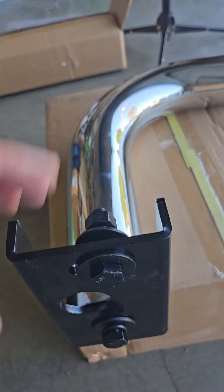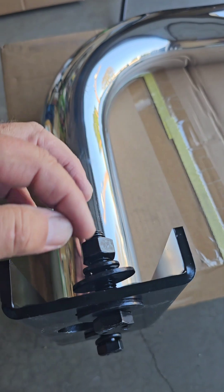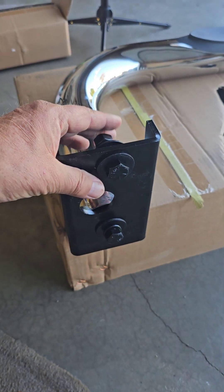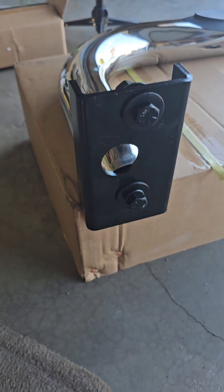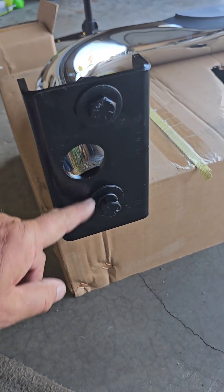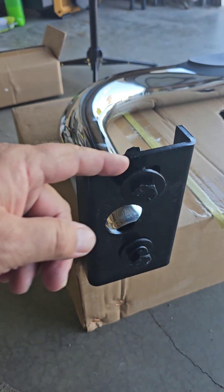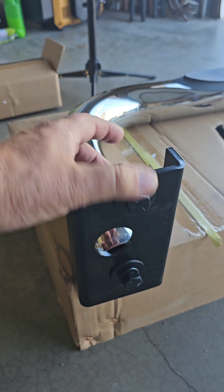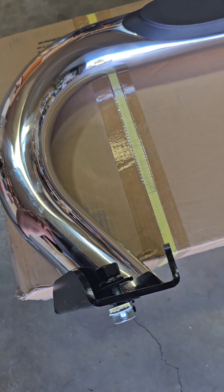Now when I got this all together, I had two washers left over. So that's when I figured out they must want a washer on here also, because on the other side you've got the big washer, the locking nut, and the nut, and that's going to hold that to the frame. Same thing down here as the front — you've got the bolt, locking washer, and a washer that screws right into the Nerf bar, just finger tight so you have some adjustment. This one will slide up and down, this one slides back and forth. So I went ahead and put one washer here and one on the passenger side for a little more stability. It's exactly the same except opposite on the passenger side — the wide one goes to the curve, otherwise because of the angle it would not fit in this flat piece of iron.